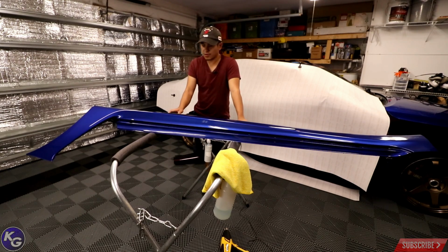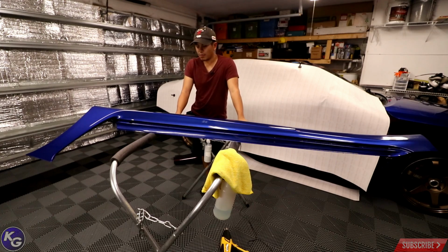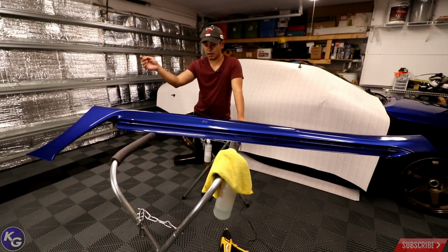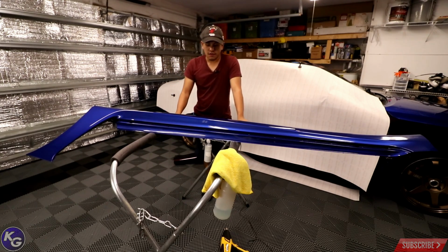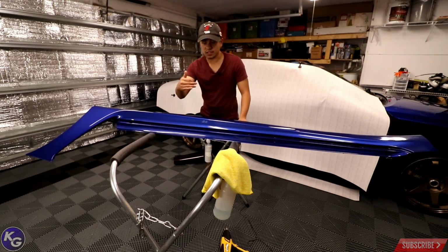So I just went ahead and wiped everything down, cleaned it all up. I still had some adhesive from when I was rose gold, just in some areas. The thing about most vinyls is when it lifts up and it's like an air bubble, over time, when you pull the vinyl off, the film that's the air bubble is off, but the adhesive is still stuck in that area that you fed it into. So if I had an air bubble right here in this deep 90-degree angle, when I pull the vinyl off, you would see adhesive still stuck in that 90-degree angle crevice or recess.